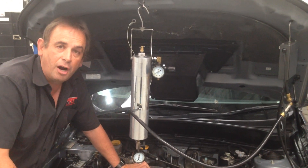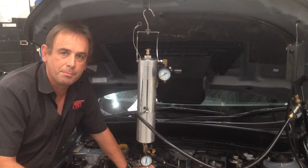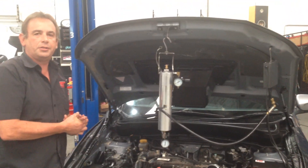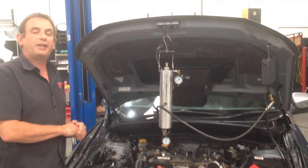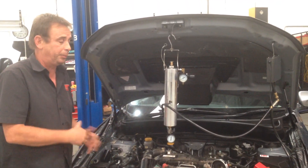If you don't look after the car and environment to allow that to happen, the diesel particulate build-up in the DPF can get more and more to the point where the back pressure is measured by the sensors down there. You'll see one of the sensors is this one here — there's a Bundy tube that comes off here which measures the before and after pressure. This part here is all the exhaust manifold coming off the turbo, which has got the catalytic converter and the DPF in it. If the before and after back pressure either side of the DPF filter is too high, it indicates it's blocked. It will try to regenerate, but if it can't, it'll start flashing the light on the dash, or in extreme situations the car will start going into limp mode and won't run properly.